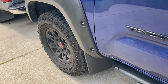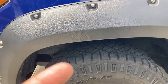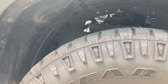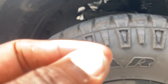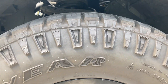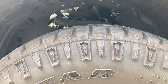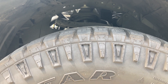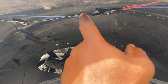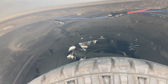With butt connects, you've got to get a butt connect where two wires come in from one side and the other wire comes in from the other side. It may be too small because you're doubling up — you have two wires meeting one — so one side might not crimp well. That's why some people solder. However you do it, just tape it up and heat-shrink it.